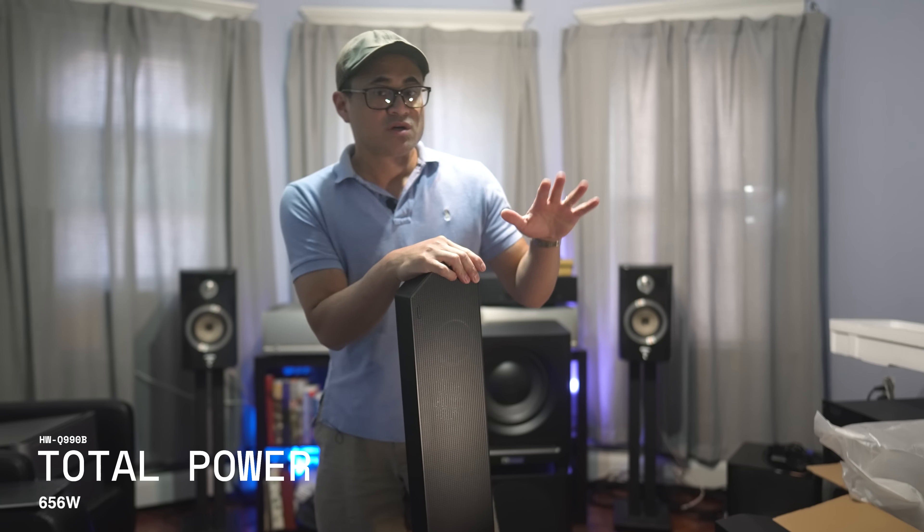I'm going to be hooking up the soundbar through its HDMI eARC input into the TV's eARC. The subwoofer is in the front left corner of the room and both surround speakers are behind my chair on stands. Be sure to leave a few feet from the side of the surrounds so the side-firing speakers aren't blocked by the wall. If your surround speakers have a blinking blue light, hold down the ID Set button for five seconds until the light turns solid blue. The same steps apply if the subwoofer has that blinking light.